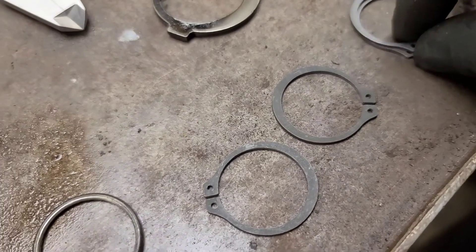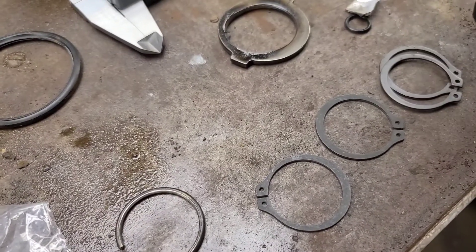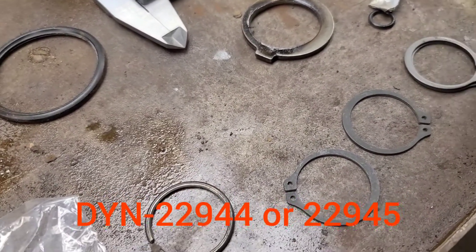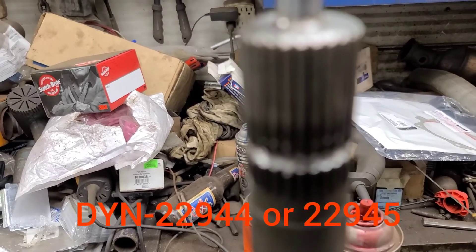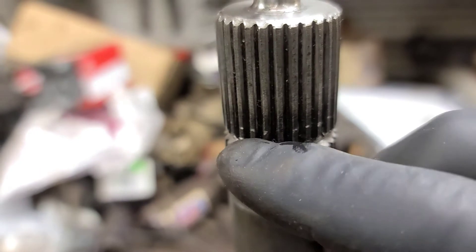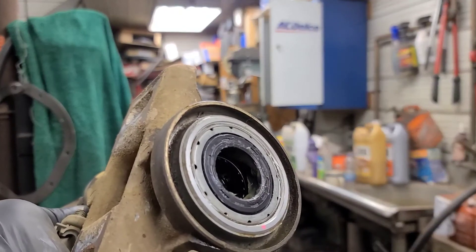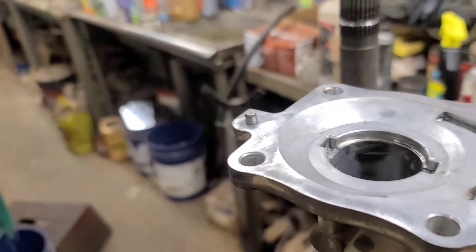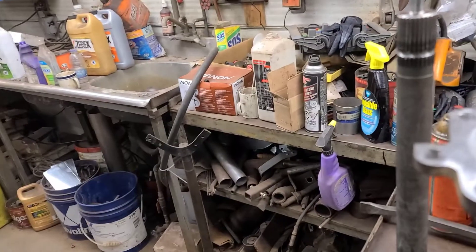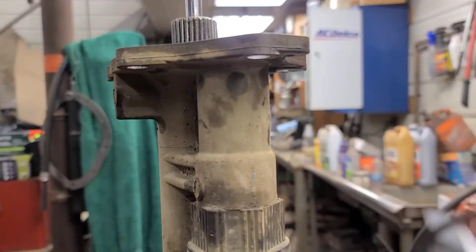I managed to get a couple of these style snap rings from Napa. I can't really be sure of the part number because they were all mixed up in the bin - I'll post the number I think they gave me but I'm not 100% certain. I've cleaned up this groove on the shaft with a zip cut blade to kind of square the edge of it, and I'm going to put two snap rings in there. I decided to replace that outer axle seal simply because we're here - it wasn't leaking but sure as I put it together without changing it, it will leak. I've cleaned the gasket surface off and we're going to reassemble the axle shaft.